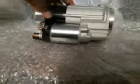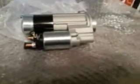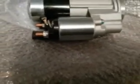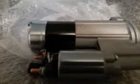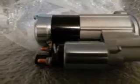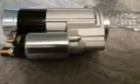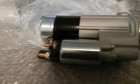I'm going to tell you, you'll be doing the same thing again sooner than later. Don't buy no used parts, man. If you can, buy brand new parts. And like I said once again, once a car get over 100,000 miles, I recommend you replace the starter, the alternator, your serpentine belts, fuel pump if necessary, water hoses, and stuff like that, guys. Timing belt if your car has one. And that's some of the basic things you need to change. Fuel pump, fuel filter, starter, alternator, serpentine belts, and water hoses, you know. Because, like I said, I don't believe in used parts. Not me. If I can get new parts, that's what I'm going to buy. I ain't put nothing used on my vehicle.